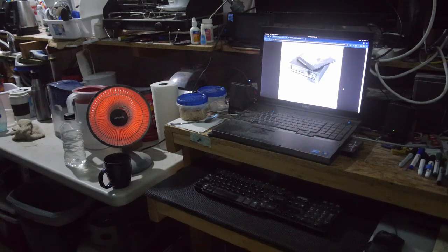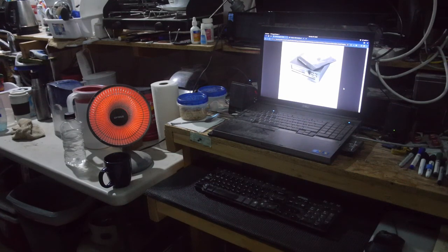This little electric heater pulls a little bit less than 300 watts — I think it's 275 or something. It draws less power than the coffee maker does. I moved my lithium batteries inside because you're not supposed to run a lithium battery colder than about 40 degrees. So I thought rather than insulating or heating my battery box, why not just bring the battery inside — and if it is that cold, I'll run a heater to warm it up. So in the evening, I go outside, shut off the outside inverter off the main system, and switch over to the inside system off the lithium battery.